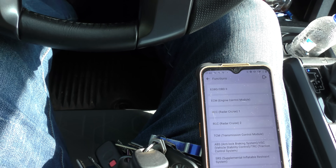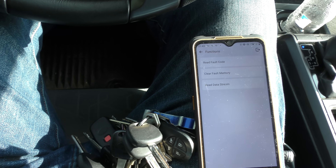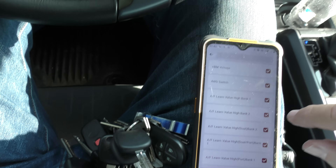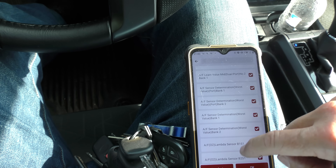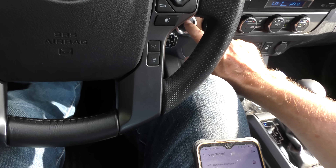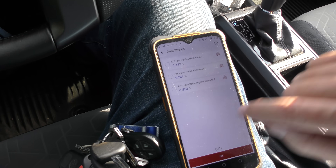Now let's say we want to look at data — we'll look at all systems. Here's the engine control module. We can read codes, clear the fault, read the data stream. I selected them all — there are 324 data parameters. That's a lot of data; this is a serious scan tool. We'll start her up to get live data. Not only can you see the data, but you can do a graph combination — it does the graph combination of three parameters at once. This is a pretty serious machine for 80 bucks. It does stuff my $5,000 machine does; of course it doesn't do it all, and it refreshes slower because it's using a cell phone. It doesn't have nearly the capacity — it has a slower chip and less memory — but it still works.